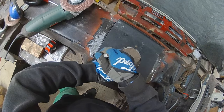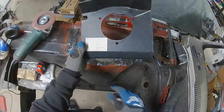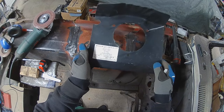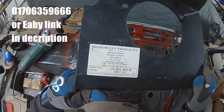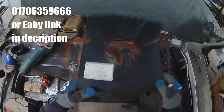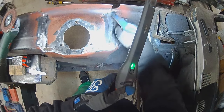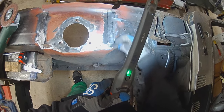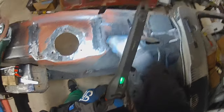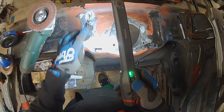Now I know why there's a giant hole there - because there would have been a smaller hole there and it's rusted around it. Take the strengthening plate away. By the way, this is a Magnum Panels strengthening plate - Magnum Panels make pretty good parts. I'm sure you can see the telephone number from there. So now I know that everything this side of this line has got to be absolutely mint. I might just be able to skim that with a little bit of filler to hide it a little bit better, because otherwise I'm just going to keep welding it, grinding it, and I could be at this for years. Everything this side of this line has got to be minted.